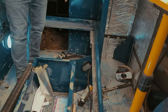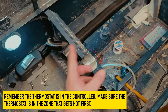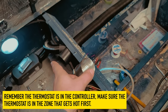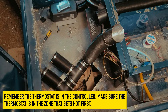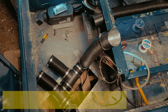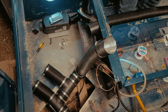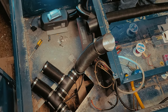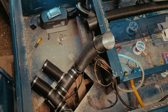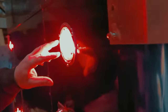A little airflow keeps things warm under the bed — your gloves won't be frozen. There's a return in here so it can only cycle a little bit of air through. One thing that does happen when the fan is on high is it does blow out the Webasto some too. If I have to I can put a one-way valve in there, but it has so much airflow that even though it's blowing out of there some, it's really blowing strongly everywhere else.